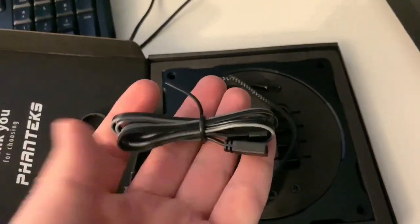It also comes with an extension, which looks like it's about 20 inches also. Before installing, shut your PC down and turn off the power switch in the back so it doesn't have any power going through it. You can actually unplug the plug that goes into the power supply just to be double, triple sure that you're not getting any power inside the PC itself.